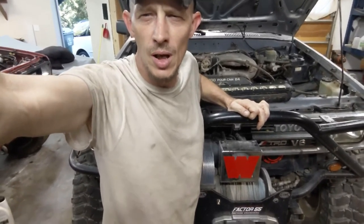I scored this winch back in '08 for a song and a dance — basically got it for 300 bucks. At that time I resealed it and put it on the synthetic line. I ended up putting on another set of solenoids because Albright's weren't the thing at the time, or it was too much money. I ended up building a new solenoid plate. You can see I put together this stainless steel cover.